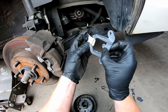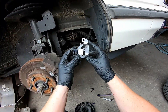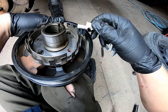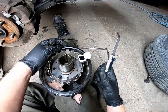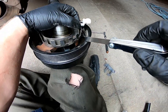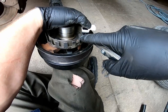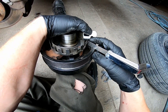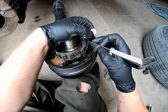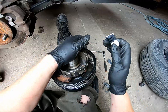The sensor is going to sit in the bracket like this. It's kind of a tight fit, but it's going to be mounted in the bracket, and this sensor is going to go into these teeth like this. I'm showing you now before it's in the car. You want to use a feeler gauge — we're going to go to 0.020 inches. Stick it in between the outside of the sensor and the first part of the ring and push it all the way against it. That'll give it enough clearance so it's not hitting anything when rotating. You want to check it in a couple of different locations, so rotate the crank a little bit and check it to make sure it's not hitting.